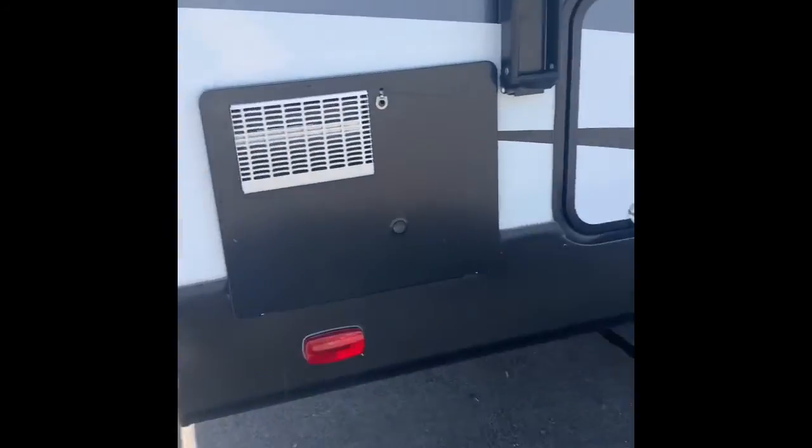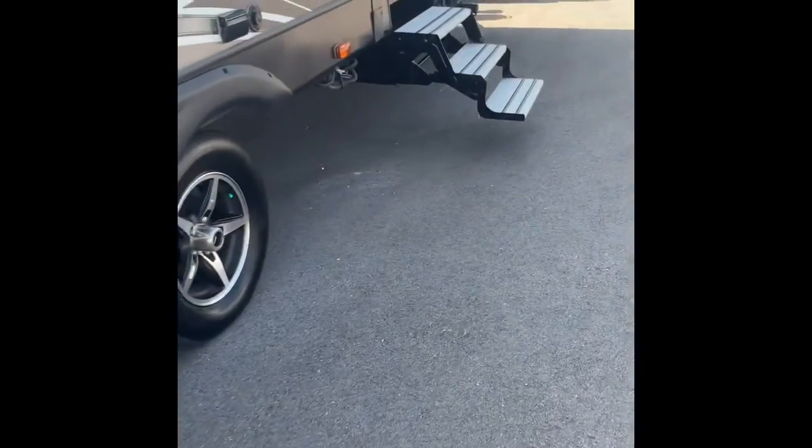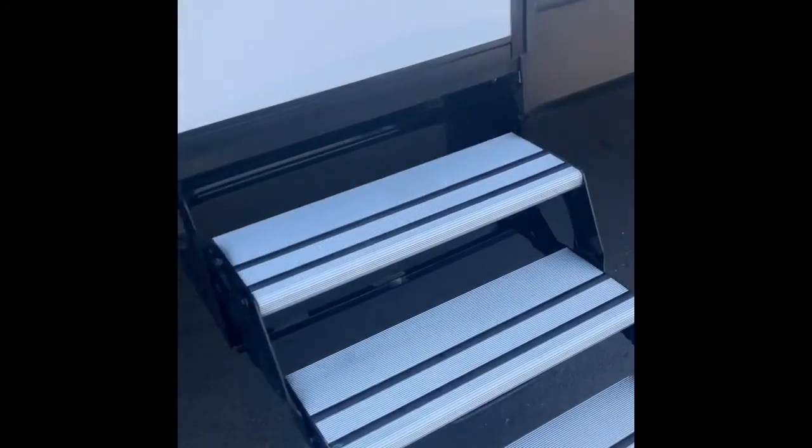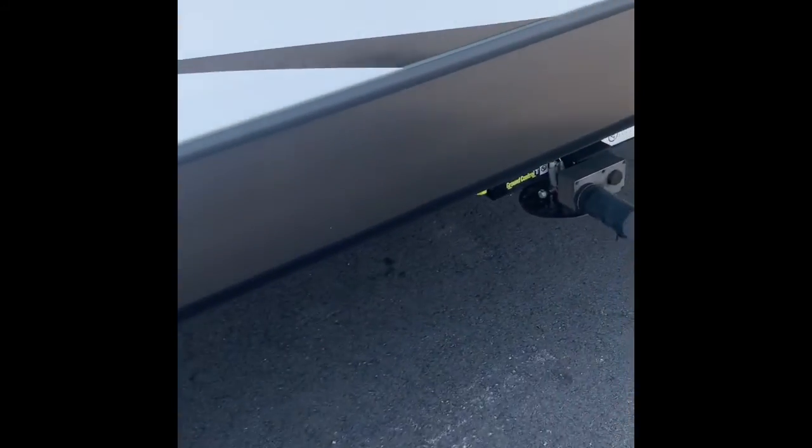When it is time to winterize, I don't know if you've had campers before. If you have, it's pretty much like any other camper. You get to the back of your water heater and go to the bypass lines and turn those, and then you go to your water pump inside, and we switch the valves around to where you pump antifreeze throughout the lines via your water pump.